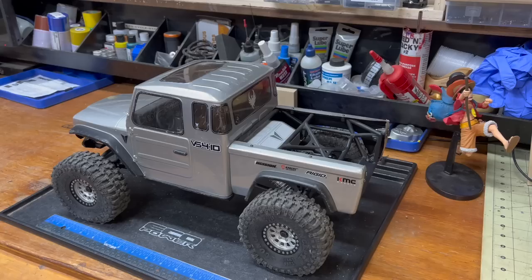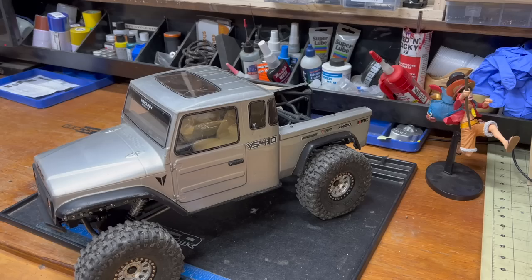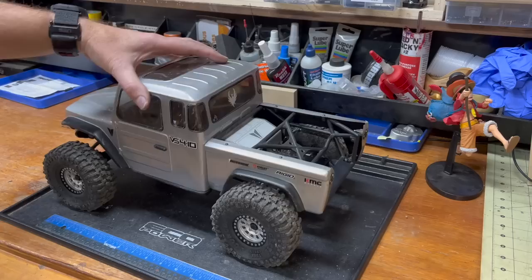Post-final assembly. Honestly, I would say... Something's weird. I would say now a couple disclaimers here before we go out. You can see the angle of that rear shock, and that used to be straight up and down. So being laid down like that is softening the spring rate, and it genuinely feels underdamped now.